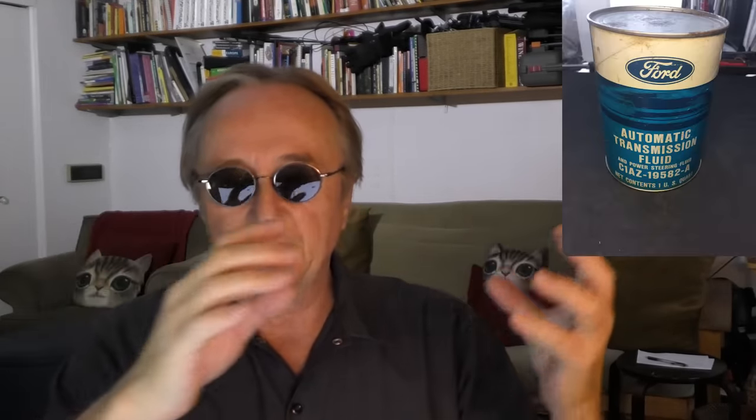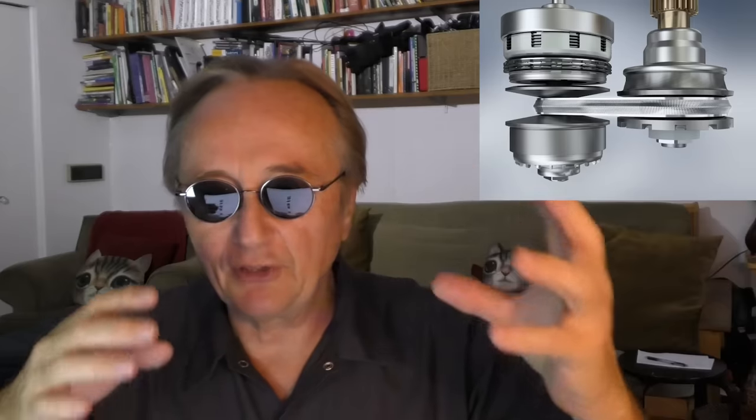Now, ages ago when I was a young mechanic in the 1960s, there was like automatic transmission fluid that fit most cars and sometimes Ford did a special one just for Fords and that was it. But now, there's a zillion different kinds. There's all kinds of different transmission designs, CVT, regular automatics, and they all come with a particular fluid that engineers design. I wouldn't go against the engineers on that one. So what if one you can get for $3 a quart and the other one is $7. Hey, you're only using 3 or 4 quarts generally.